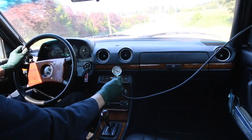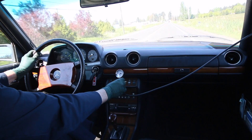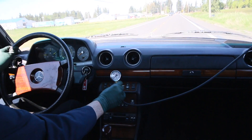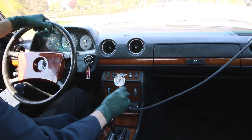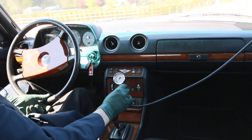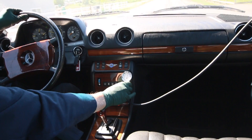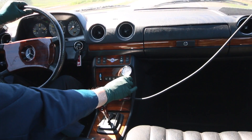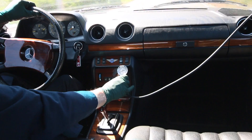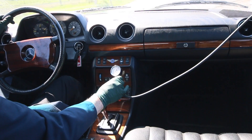This thing doesn't want to accelerate. Here comes the gauge — I'm going to stomp on it. Watch the gauge, it's going right up to nine PSI, but I'm not getting any power. The thing feels like I'm dragging an anchor out here. When I floor it, it's just not kicking into gear like a turbocharger should. See the delay in which the power comes on? The boost gauge is right at eight. I'll back it off and floor it again — right up to eight, eight and a half. So it looks like the turbocharger is producing adequate boost. But why is this engine such a dog?